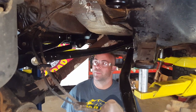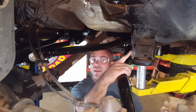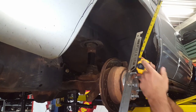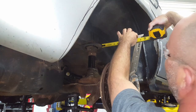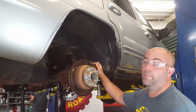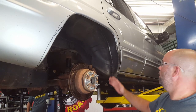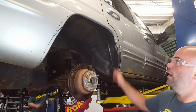While you have your coil springs out, it's a great time to make adjustments. You'll need to bend in the lower control arm mounts just a little bit — a large crescent wrench or a big hammer works well — just enough to clear the lower control arm. Also adjust your axle left to right to make sure it's centered under the Jeep. Use a straight edge to measure from the coil spring pad to a reference point on both sides and adjust the length of the upper control arms until they're equal. Then center the axle front to rear by bolting a tire on and centering it in the wheel well — we decided to trim a little plastic on the rear rather than the front sheet metal.